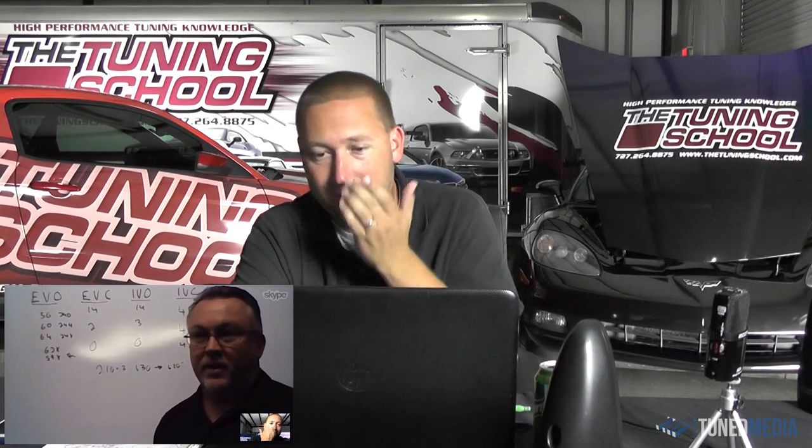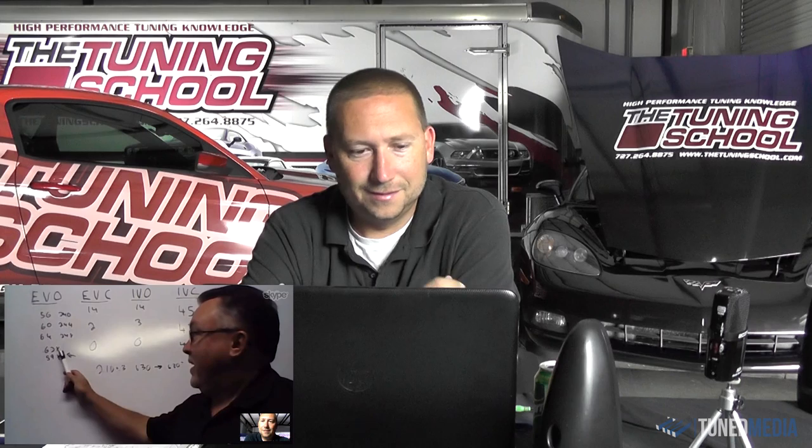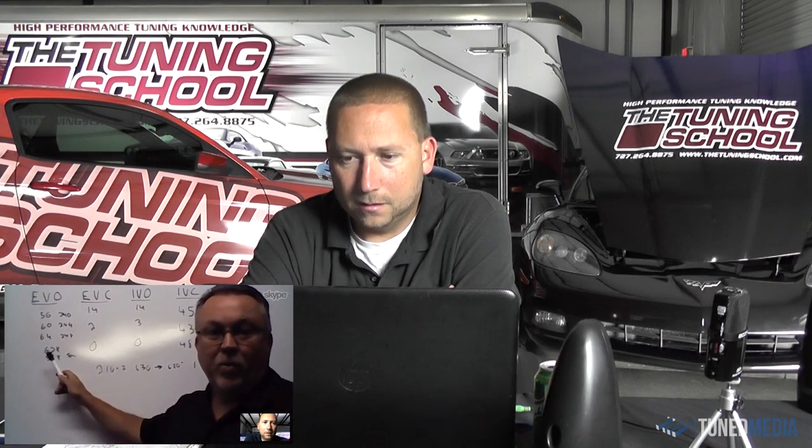It's amazing because I have a very good friend that was on a winning pro stock team, the Summit Racing pro stock team, for years, and he did all the camshaft testing, spintron testing. And I asked him, did you ever test running all less exhaust lift? Nope, not one time. I don't know anyone who's ever taken two cams, tested them back to back on an engine dyno with only a change in exhaust lift to see what the effects were.